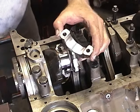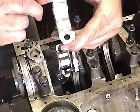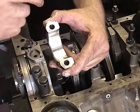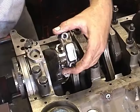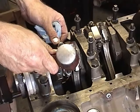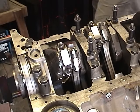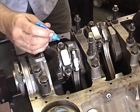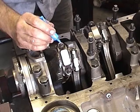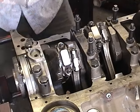I've already got my bearing cap here ready to go — cleaned up and put a new bearing on it, with a little assembly lube on it. Remember, line up your notches. These lock tabs will go tab to tab — one tab here, the other tab on the rod will be lined up with that one, so that's an easy reminder. I'm going to go ahead and put that on like so. Sometimes you have to tap it a little bit with a hammer, which wouldn't hurt anything. We're going to put a drop of Loctite on the threads for added safety. Just enough to coat the first few rows of threads will be fine.